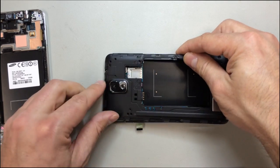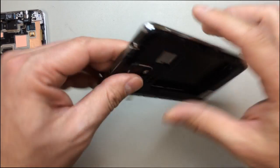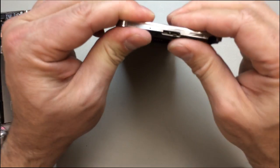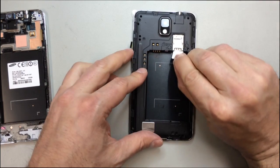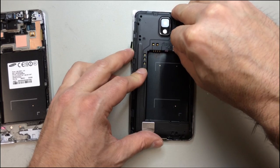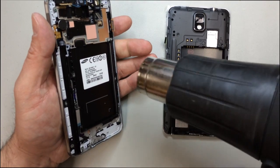And what we will do is go ahead and set the panel on the back here just long enough to get the battery installed so that we can make sure that the screen is functional. Since I don't have a test cable for the screen, I had to go ahead and put the logic board inside the phone. But as you can see, it didn't take too long. We're about 7 minutes into the process at this point.